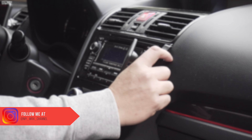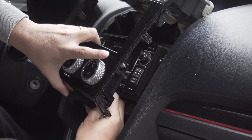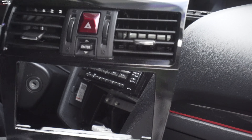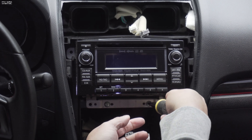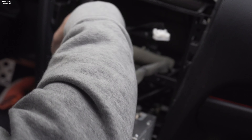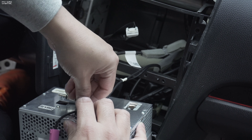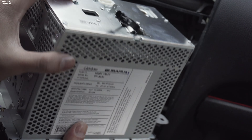All right, let's get all of this stuff installed. It's been a while since I've taken all the stuff out. All it was was taking out this one harness at the bottom. Now this whole trim piece comes out — from what I can tell there's six screws I gotta take out. Looks like this bracket came out. Got one clip undone that was at the bottom. Just undo that, hold this through, and now your head unit is completely disconnected out of the car.